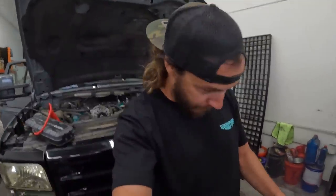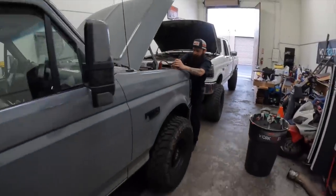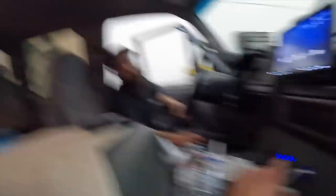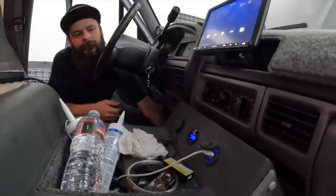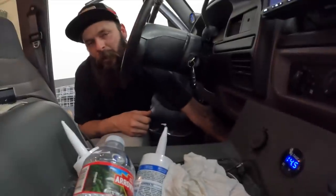It's the blind leading the blind — when a Ford saves a Ford. Come on, old girl — she's still got it. Zach's truck has that high idle going. It went up — when this one kicks on it'll go to about 14 volts. These batteries are so dead that if you start it and pull the jumper cables they trickle back. They've been sitting for a very long time. You can see the dome light flickering — that's the glow plugs turning on and off. This truck needs new batteries — when batteries go, they're gone.